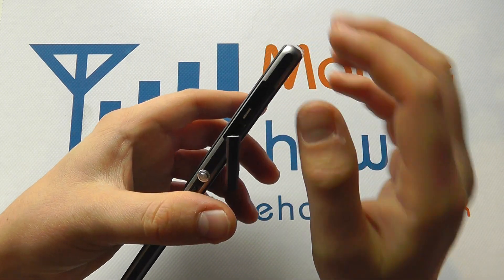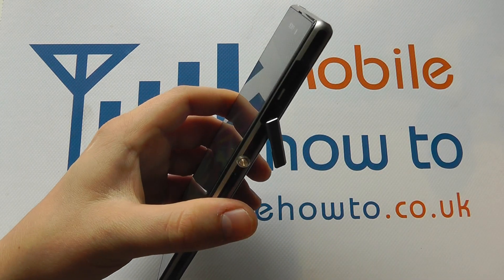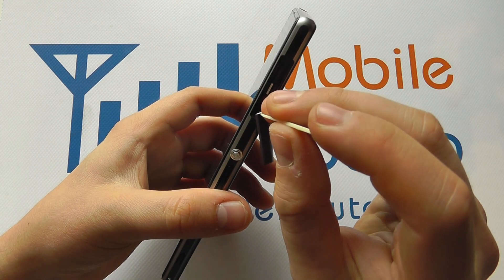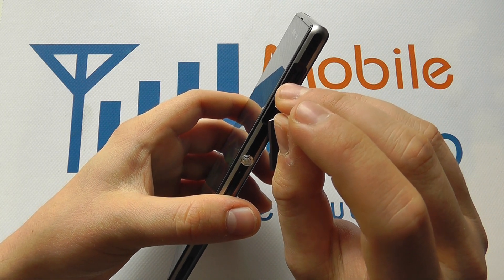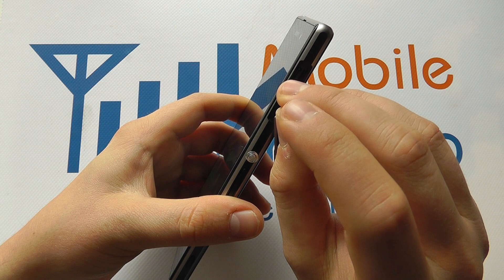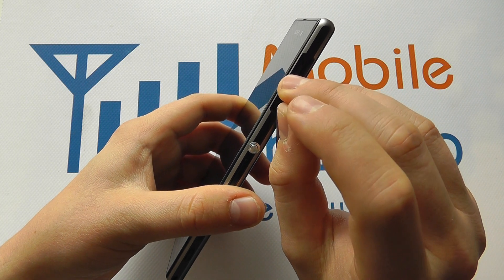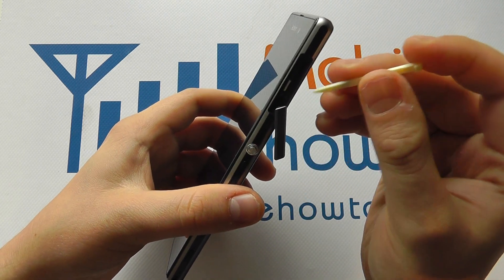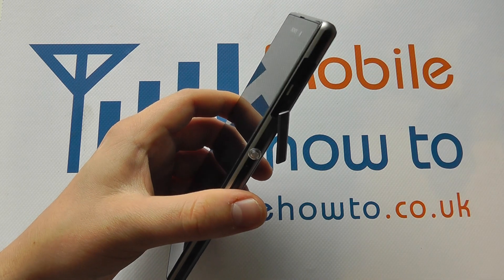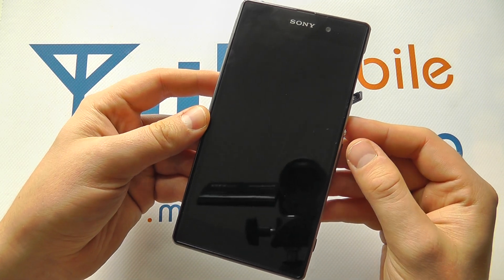You need to use something like the tip of a pen or a pencil — in this case I'm going to use a little pick — and press on the red button for about three seconds. You'll feel the device vibrate three times quite fast, then you'll be able to remove the press on the button, and the device will have now been forced to turn itself off.